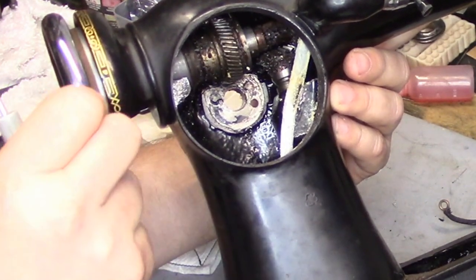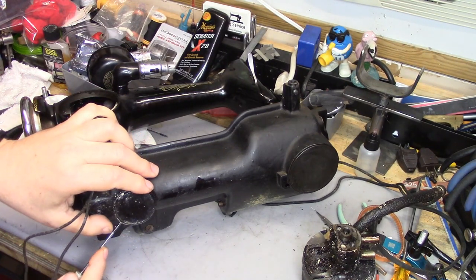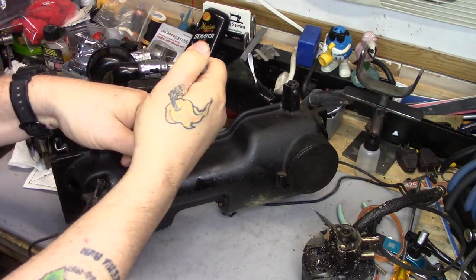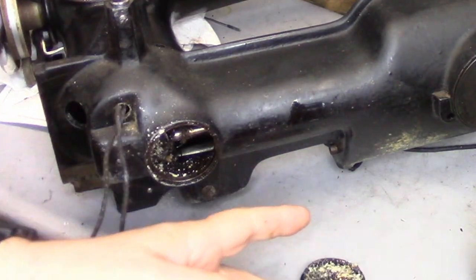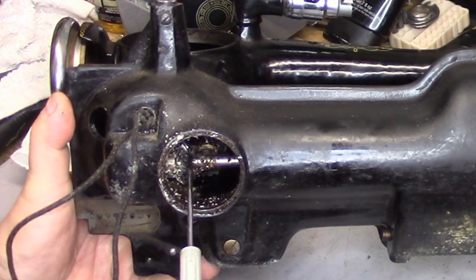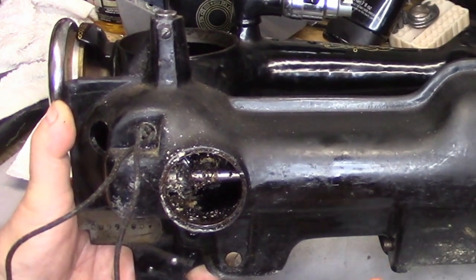These are pretty precisely fitted gears. I haven't pulled the light assembly off the machine yet, but let's pop this bottom cover off. I'll show you another issue with having that lead in there — you can see all this crap that's laying in that access cover. That's crud from the lead, and you can see what it's done here. There are two gears in all that mess. All this crud is going to have to be cleaned out, and it's going to take a bit of time.